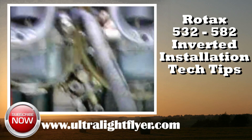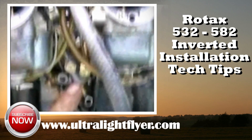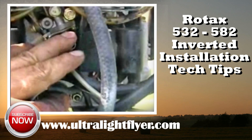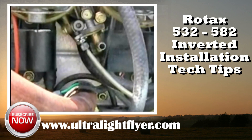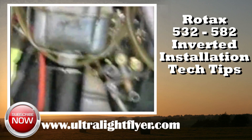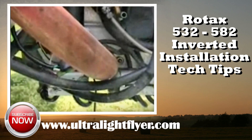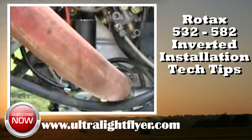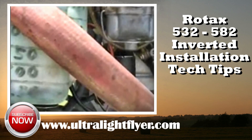This engine is using oil injection. This is the oil injection tank here, and this is the oil pump here. The problem is that the oil injection pump is a gravity feed from the tank to the pump. In order for this pump to work, it has to be fed by gravity from this tank. As you can see, the feeder for the tank is below the pump, which means this pump will not work if the oil gets below the 500 milliliter mark on the tank.